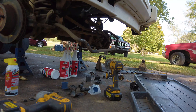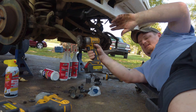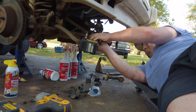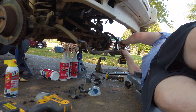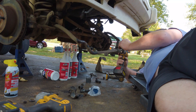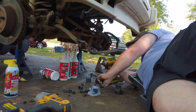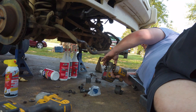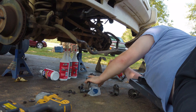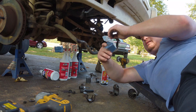So we're going to take our wire brush here and clean the sway bar off real good. Get the other side too — just do a little light brushing with this bracket holder because it really isn't that dirty. This one's got a little debris in the bottom. I'm going to coat this with PB Blaster to help the bushing slide in correctly.